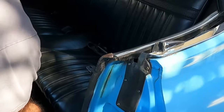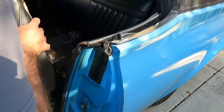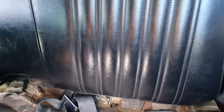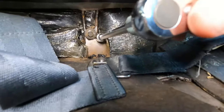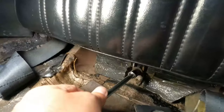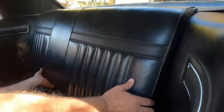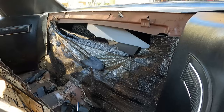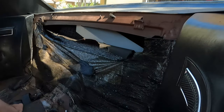To take out the seat bottom it's pretty easy — just pull it up and carefully take that out. Now to take off the back part of the seat, there are two screws down here, one on either side, those are 3/8 inch. Then the back should just lift up — pull it forward and wiggle it up a little bit, and you can see into the trunk. The little mat here is falling down; it usually goes into these clips.